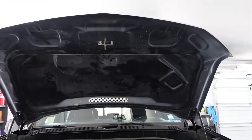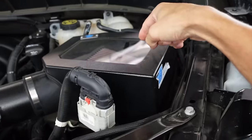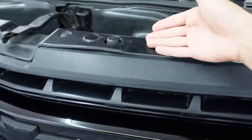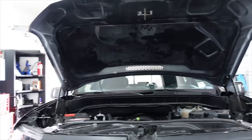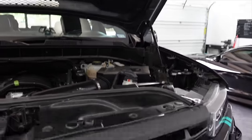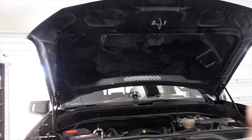As far as the design of the RK Sport hood, the concept and idea of the Ram Air functional scoop is pretty cool. You'll see some of the ductwork under here and this opening, which the Ram Air funnels air directly there, blowing on top of our air box, which actually pulls its air from up here, not over there. So essentially all it's doing is just dusting up the engine bay a lot quicker. But the idea and concept is cool — if you want it functional, you'd have to pull that entire box head off and have the air rush directly on top of that filter, but it does take out any protection that this natural flow of air would provide.